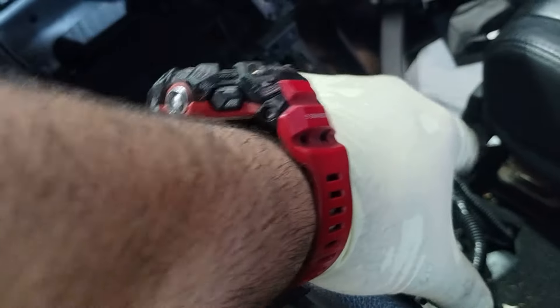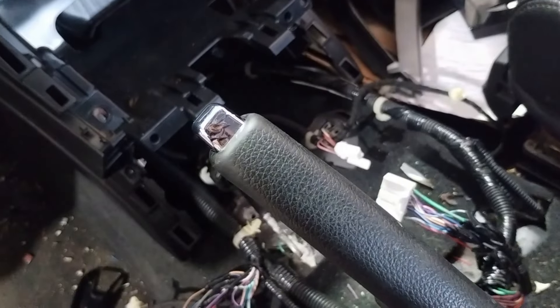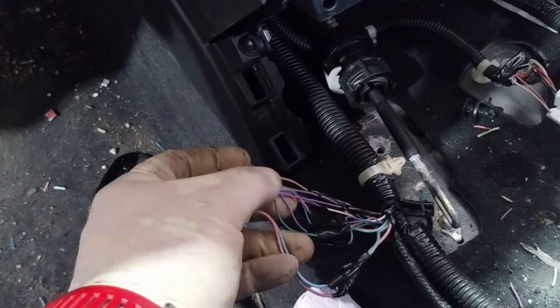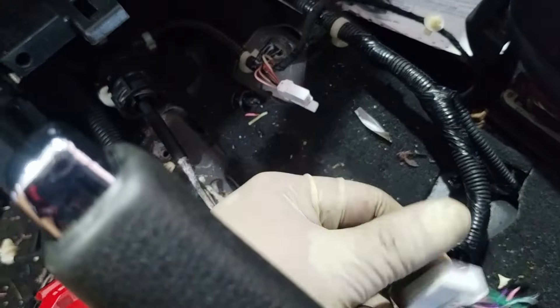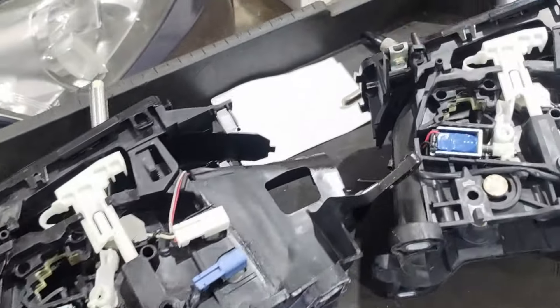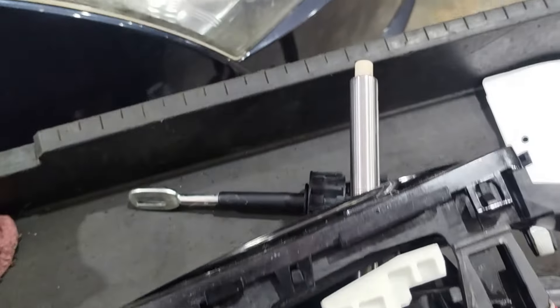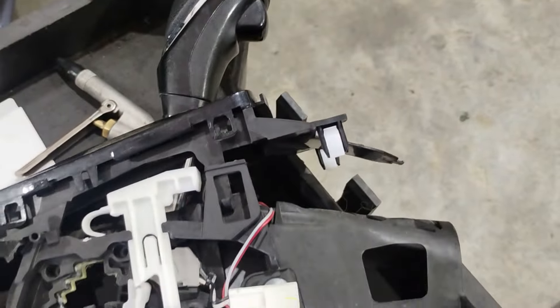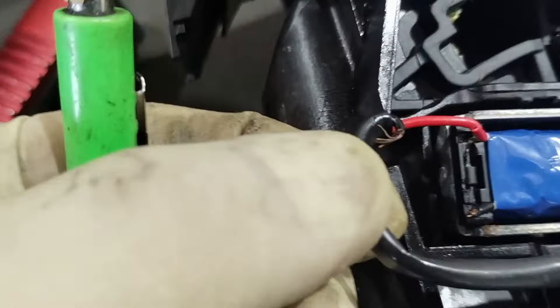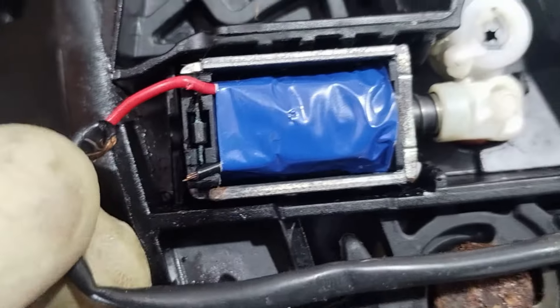This signal is going to be from the shift lever floor assembly here. Everything else kind of worked and I checked the wire color — that was not the issue and was okay. But what I did find out when I came to take a look: the one with the knob removed is the one that came out — this is a replacement unit. So what I ended up finding when I was in the car, I noticed this solenoid which is the shift interlock.